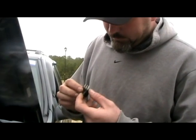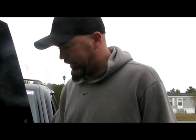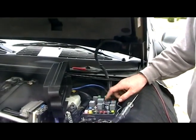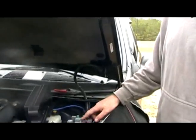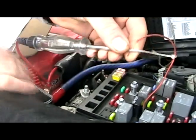These modules are like 30 to 40 bucks. One more tip: 2008 and up trucks only have one of these, so you can't do the first step of swapping, because they did away with the electronic clutch. That means you'd really have to do the full testing we walked through. We're going to take our test light, hook it up to the positive of the battery, touch the lead — and it didn't work.